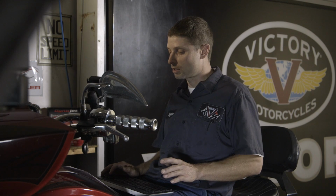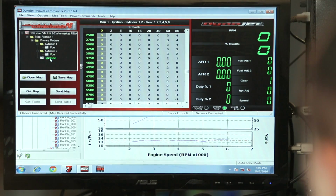And then the last thing I wanted to talk about, well, the second to the last thing is the ignition timing. I just put some generic numbers in there. And really, ignition timing should be adjusted on the dyno. The numbers that I've got in my generic maps are very simple and low settings that really shouldn't be advanced unless you have the aid of a dyno. So I put some timing into these, but sometimes you might just zero them out and see where that gets you.